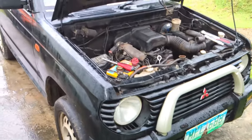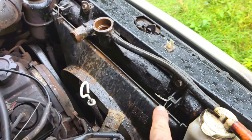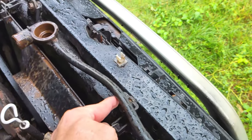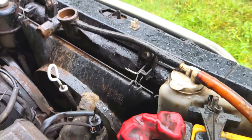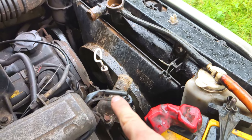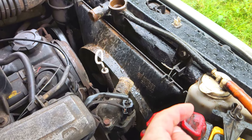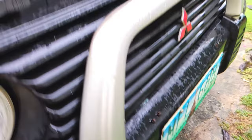I wouldn't mind getting one of these one of these days. So first I'm going to cut the wire ties and pull this back — the radiator shroud — and we've just got two 10 millimeter bolts there and one over there, and my guess is it could just pull up then with that bottom hose removed. Down there we've got a spring clamp on the engine side and a screw clamp on the radiator side, so I can't get to the screw clamp without taking off the skid plate underneath. And I would prefer not to have to climb under there right now in the rain.